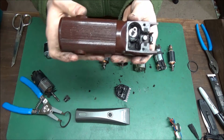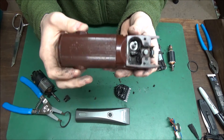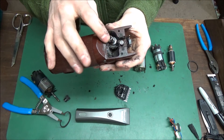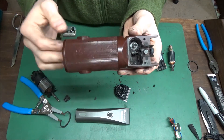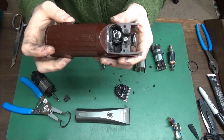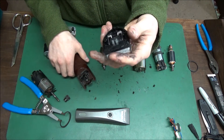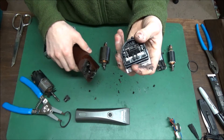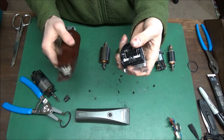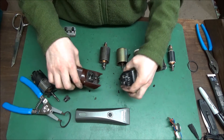The first thing you know when your clipper is bad is when it leaves lines. If your clipper leaves lines, it needs to be serviced — something has play in it: the lever, the post, maybe a bushing is wearing out. It should never leave lines. So if you just got your blade sharpened and put it on your clipper but didn't get your clipper serviced and it leaves lines, you already know it's your clipper — go ahead and send the clipper in.